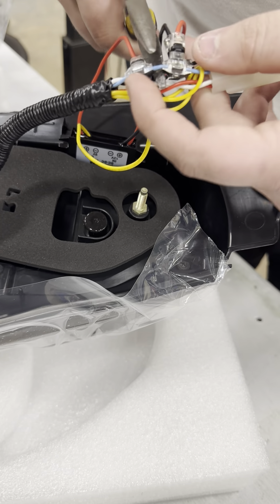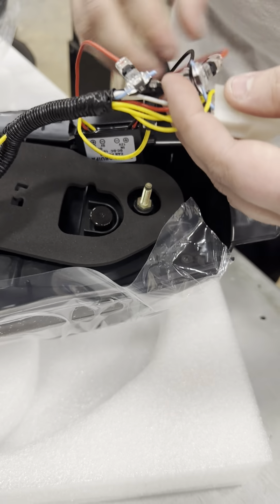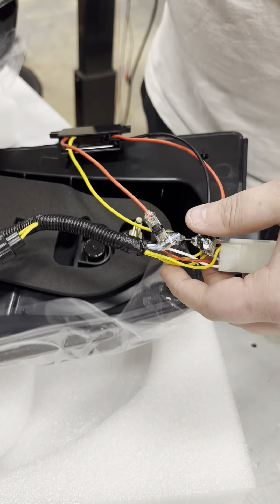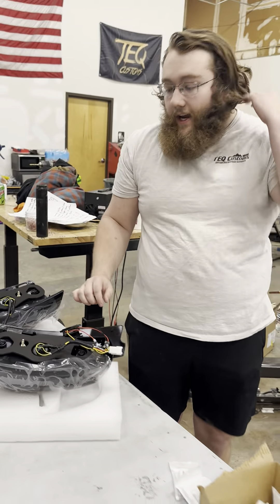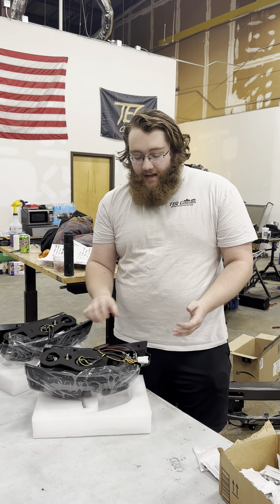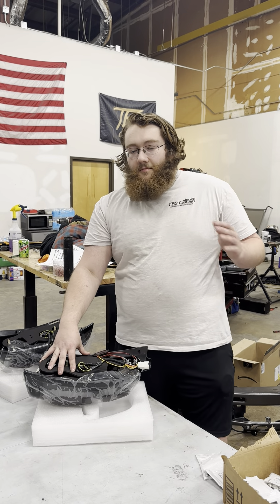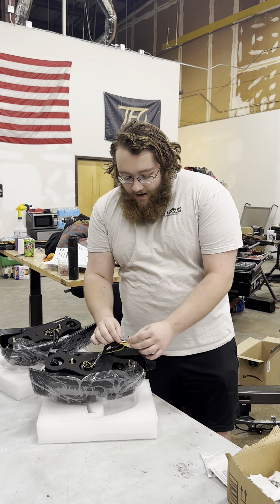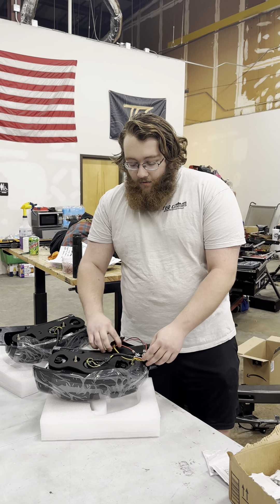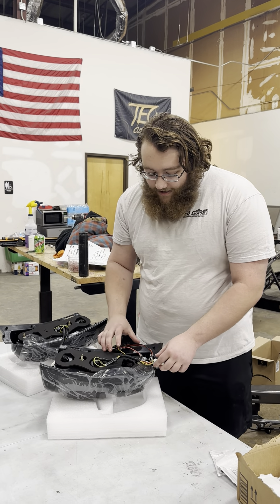Right here in the middle, we are going to cut the blue wire so the power only goes through this module and reduces the brightness of the running light. If you don't cut this wire, it's not actually going to do anything because it will still have the same level of power from the vehicle going into the taillight. So make sure you cut the wire in between, and then the power will only run through this module and reduce the brightness of that light.